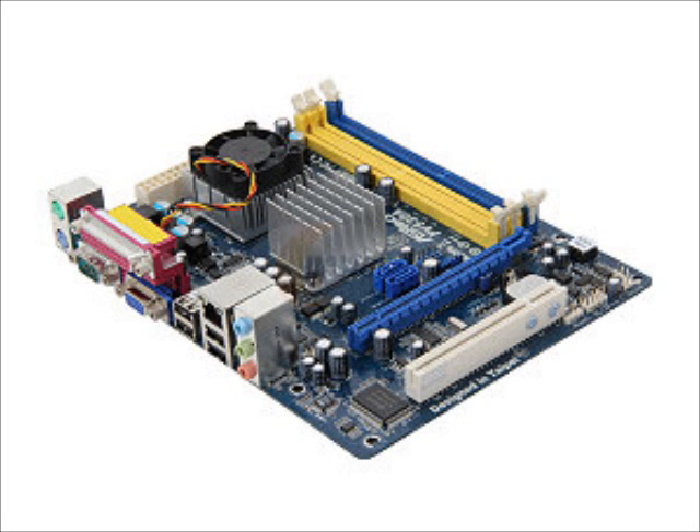To start this build off, of course we're going to be using a CPU motherboard combo, because they're cheap. We're going to be using an ASRock PV530A. This comes with the VIA PV530 processor — it's not AMD or Intel. I didn't really know that other people made processors for desktop platforms besides them. The VIA processor is built on the 90 nanometer manufacturing process — pretty old — but it's a dual core at 1.8 gigahertz, so it should be fine.